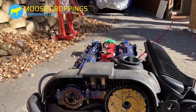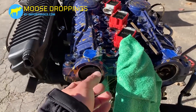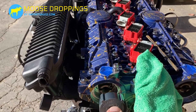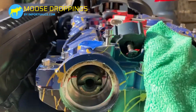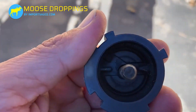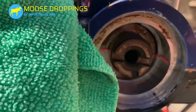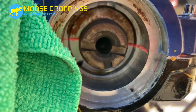Let's assume you took your gears off and you need to know how to line them up. When you pull off the sender units, these will only go on one way, as opposed to the cam gears. You have your side-to-side notches on there, and that fits into that groove at about two o'clock on the intake side. Over on the exhaust side, it's slightly offset side to side and that one's down at about five-thirty, almost six o'clock.